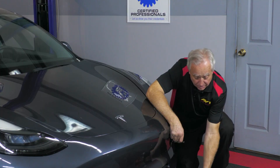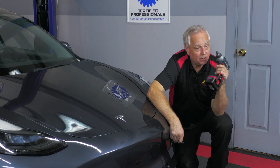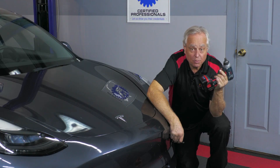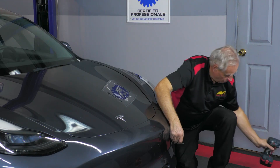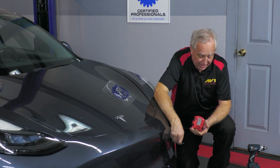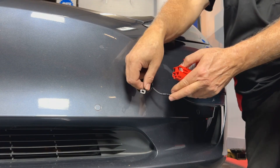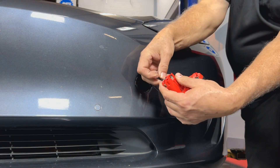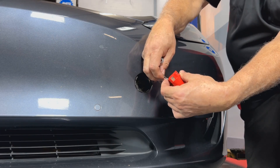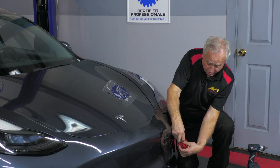So what I'm going to do — I just happen to have my Bosch power tool over here — I'm going to use the battery from this to go ahead and open this frunk. Let's see if it works. We've got a battery, and the battery is of course marked positive and negative, so we need to make sure that we follow the correct polarity. I'm going to hook up to the positive lead right over here. Now remember, this is low voltage — no gloves required. It's the low voltage battery. We've got to have the low voltage battery working to get high voltage.